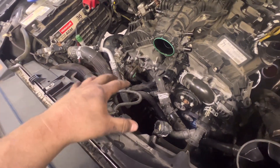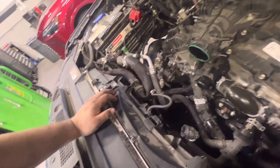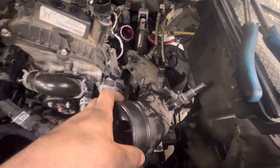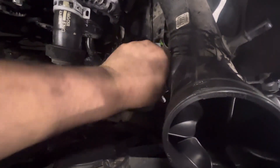With the upper hose undone and the coolant reservoir out of the way, I was able to remove the big charge pipe that runs across the whole front of the engine. That one won't come out unless you make some room. With that out of the way, I think this is the last of the turbo piping - it's pulled off the turbo. You'll want to access those clamps through the fender liners. Looks like there's a twist-lock connection here.